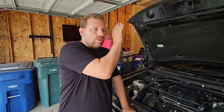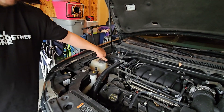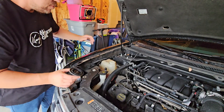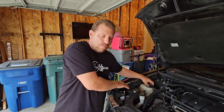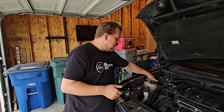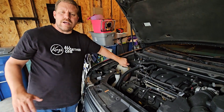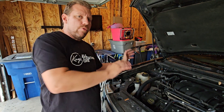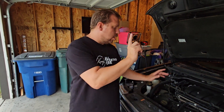A couple of ways to prevent or at least mitigate the water pump issue. Number one: this car has 81,000 miles, and what you want to do is flush the coolant. The only way to add coolant to this engine is through the overflow tank or pressurized overflow tank. The coolant should be changed around 60,000 to 80,000 miles — this coolant is probably original. You drain the radiator using the petcock at the bottom, and then put in new radiator fluid. That's number one way to help prolong the life of this water pump.